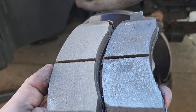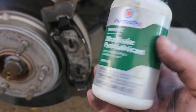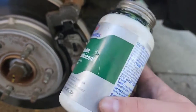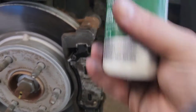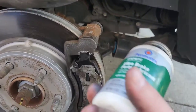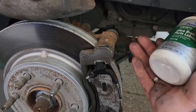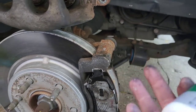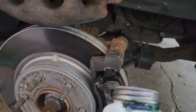So that way we can guarantee we take that little extra measure to make sure we're not getting our squeak from anywhere else. I'm going to use this ultra brake parts lubricant from Permatex — another Permatex product, also from AutoZone. What I'm going to do is use this lubricant on the pins and reinsert them, then jiggle them to work it in, pull it back out and see how lubricated we are and how easy it is to come out and back in. We're looking for easement but we don't want to overfill it with lubricant — we don't want it spewing out the sides. Just put an ample amount in there, be a little liberal with it, but don't overdo it.